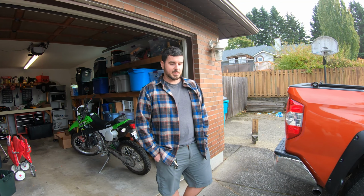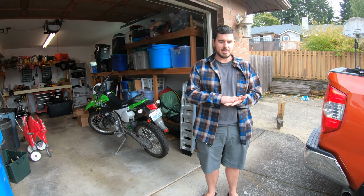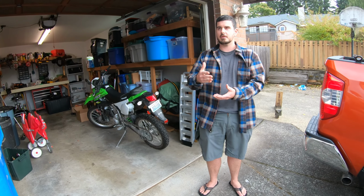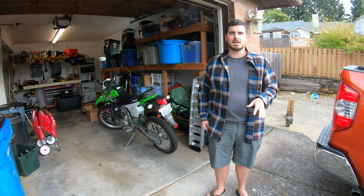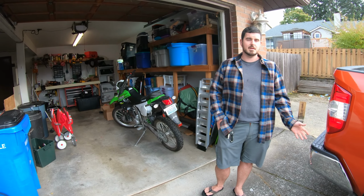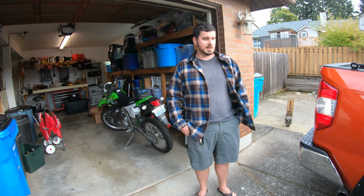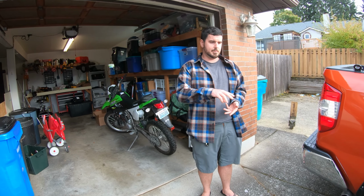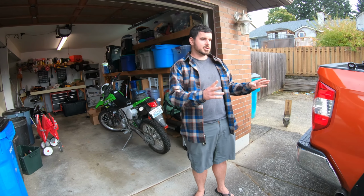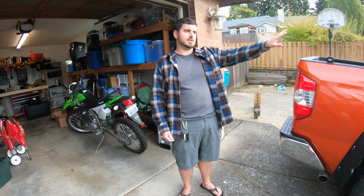Oh yeah, I've got a big setup. What are those batteries that are fully submerged all the time, so that you can tip them any which way? They have like a cloth coating around them. I forget the style of battery, but I've got basically a marine battery. It's marine, but I can't remember what it's called right off the top of my head. But we've got an inverter. It's going to be running a whole other electrical system that'll charge off of the alternator, and it's not going to be connected to the starter battery at all.